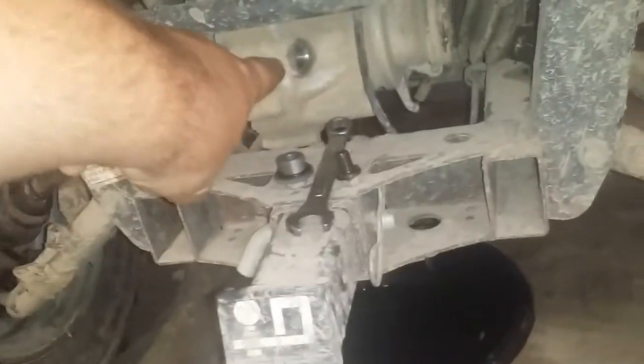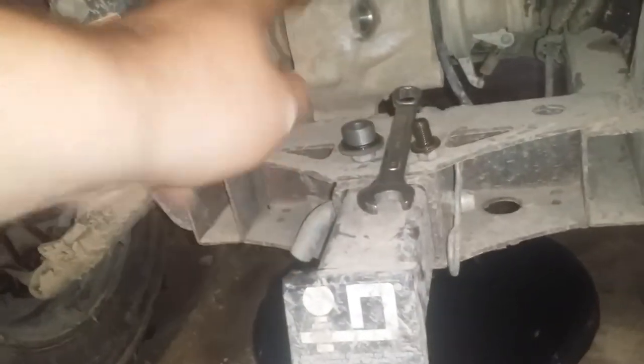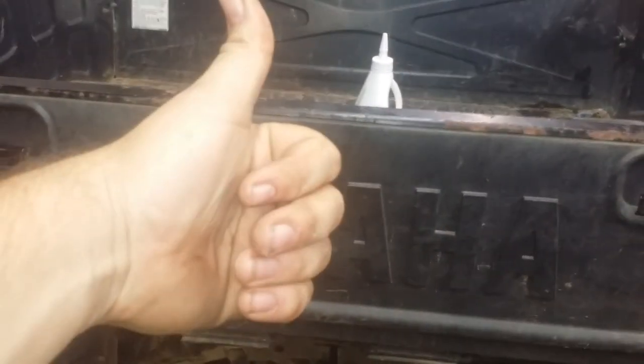Get one of these little pumps, put the hose in, and start pumping until fluid starts running back out of the fill hole. When it starts running back out, cap it and you're done. That's how you change the oil in the rear differential of a Yamaha Rhino 660. Hope this was helpful — please comment, rate, subscribe, and have a nice day.